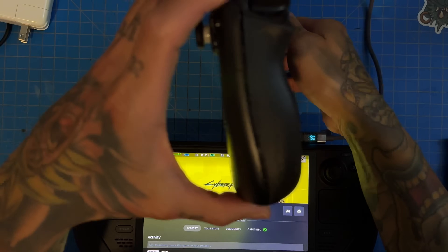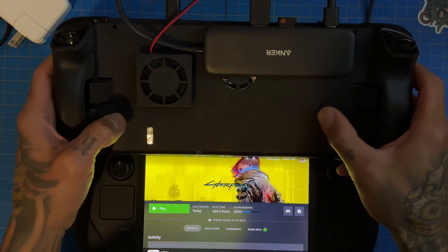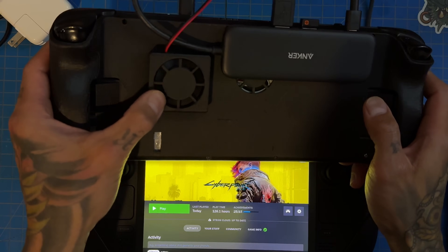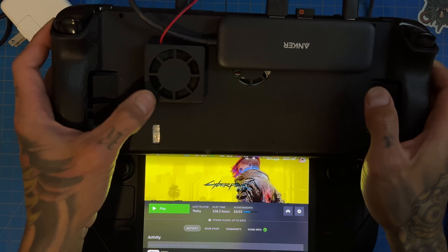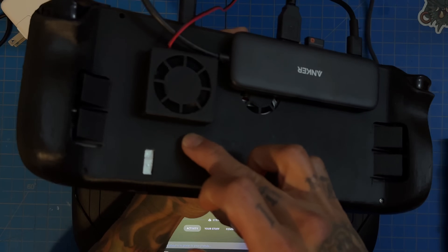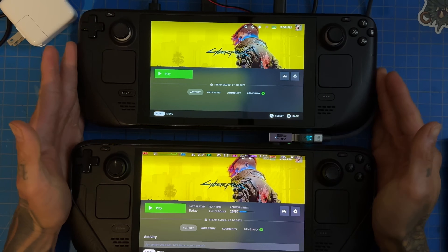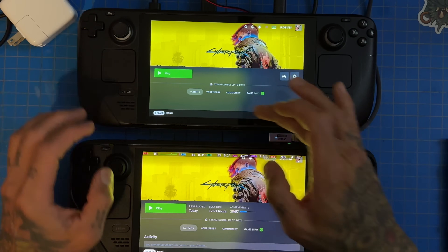Let's talk about the LCD Steam Deck — it's modified. We have a custom backplate of my design with a cutout we're not using. Mainly why I'm rocking this one is because of the fan and the vent mod, so it runs a lot cooler, especially since we're at 21-watt TDP. This one doesn't have a heat shield behind it so the fan can blow into the SoC completely and it's running quite cool. The OLED just has a grip on it.